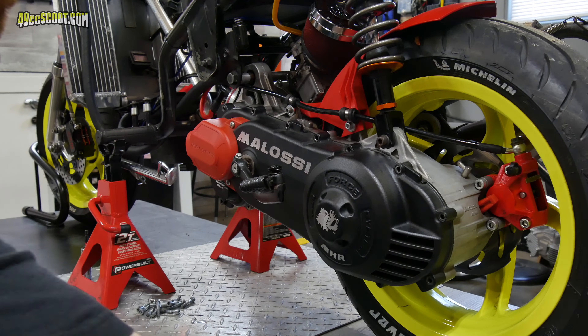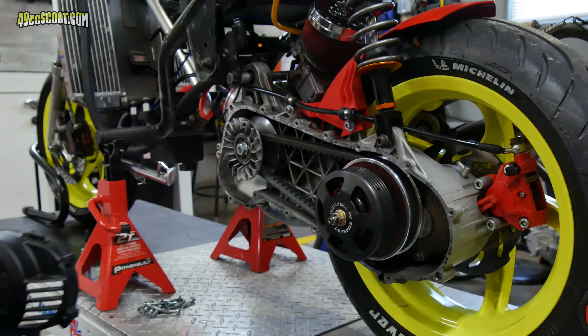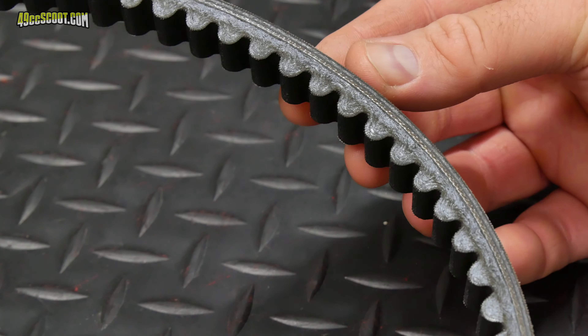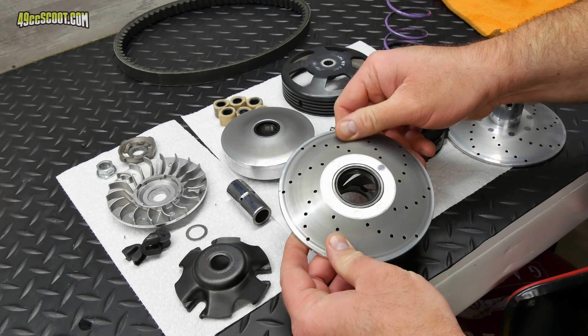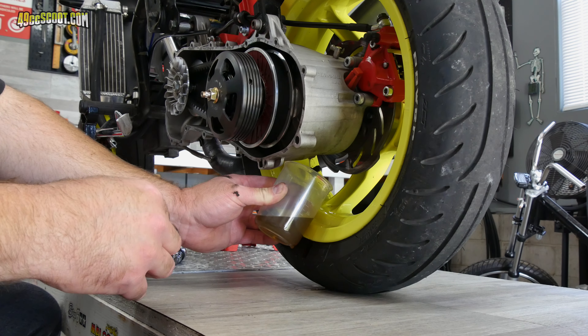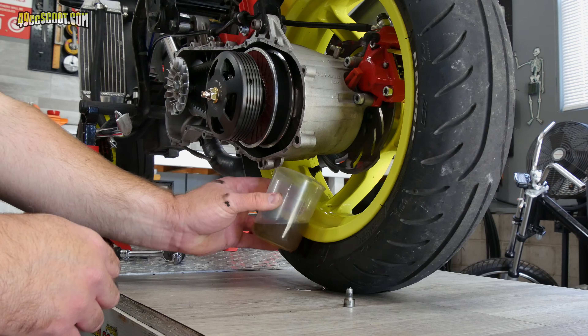About the worst I do is run up to 70 to 80 miles per hour and then go back to putting around at low throttle. After 775 miles on one belt, I opened the CVT cover to go over it and replace the drive belt. The fact that I could go that long without replacing a belt has been amazing to me after breaking or needing to replace belts every 150 to 250 miles on all of my Minarelli clone setups for years. I'm now confident that something is wrong with the over-range I've used on other engines, most likely the modified torque driver. Everything looked very good, and the belt had only worn about 0.4 millimeters from my initial measurement. I cleaned the entire CVT, re-greased anything that required lubrication, and stuck it back together.